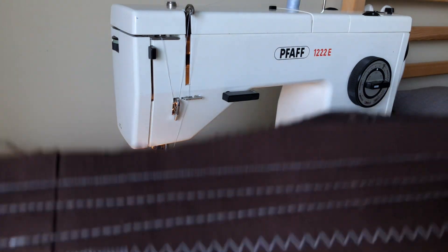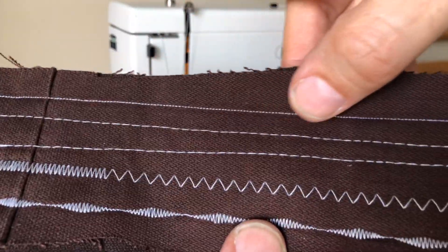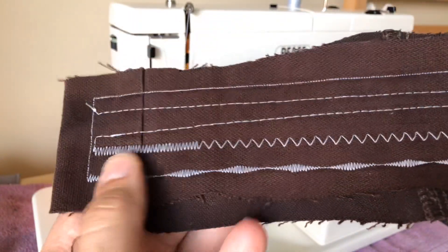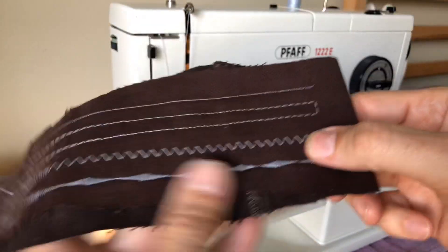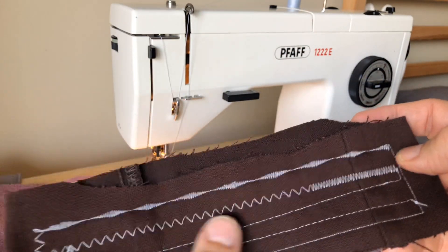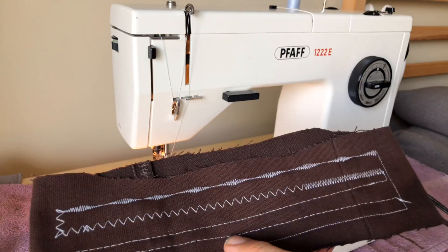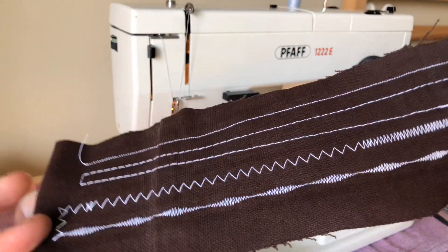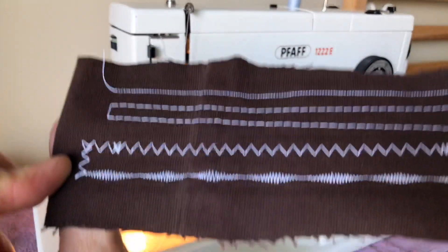Let's take a look at the sample. Here we are — you can see the rows I've done. Here's one of the initial rows: a long straight stitch with good consistency. Made a little U-turn, came back down, made a short stitch — not quite a satin stitch — then elongated it just to test it. Here's where I did the back-tack, a quick reverse. And this is one of the decorative stitch patterns. Most sewing done honestly is either straight stitch or zigzag — that's what most people use. We've got good thread tension both upper and lower, and I did not experience any hesitating with the stitching.